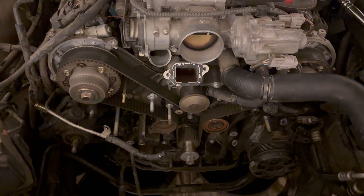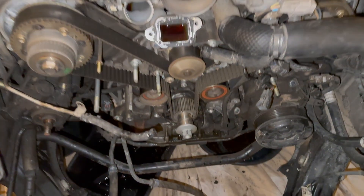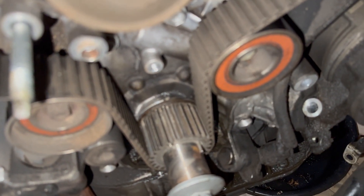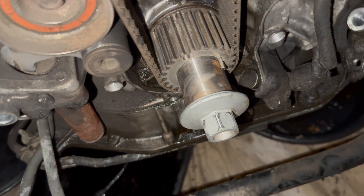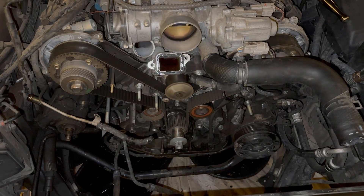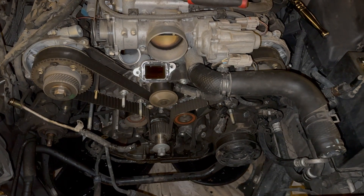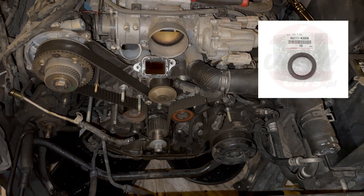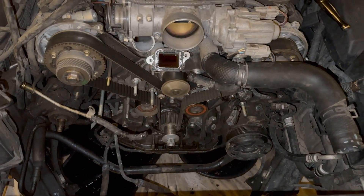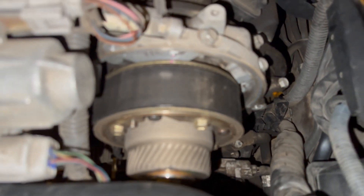I'm in the process of doing this. The only reason it's not done yet is because I'm going to buy a new crank seal because it may be leaking. I can see there's a little bit of residue down in there, so maybe the crank seal is leaking, maybe it's just stuff that ran down when I was taking everything off, but I'm not going to risk it. That's something you should do anyway every time you do a timing belt — I just didn't get it with the AISIN kit I bought. So we're going to Toyota tomorrow to buy that seal. I'm sure it's the same as every other UZ engine — the 4.7, this engine, and the 3UZ probably all share the same seals. The timing kit and water pump is exactly the same for all the UZ family engines, so I'd be surprised if the crank seal is different.